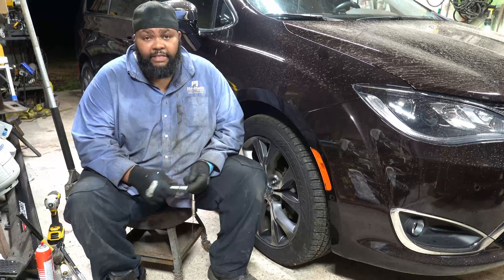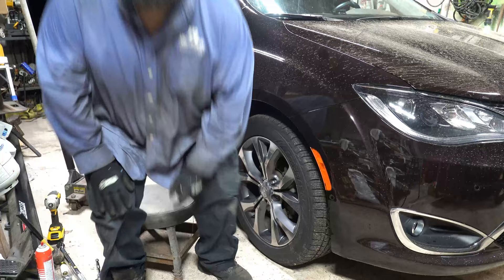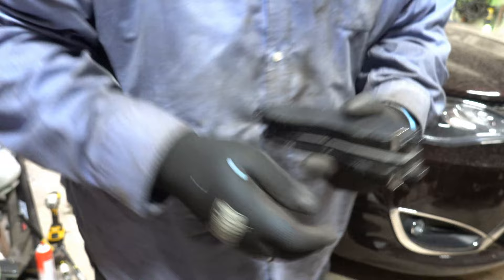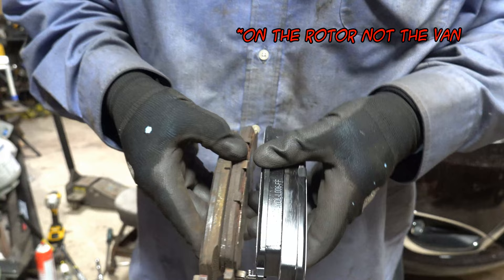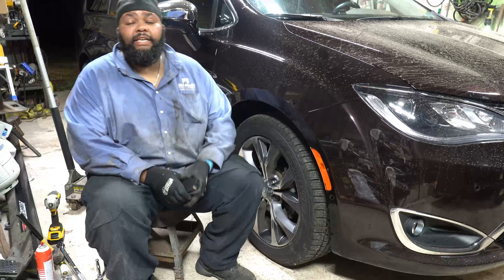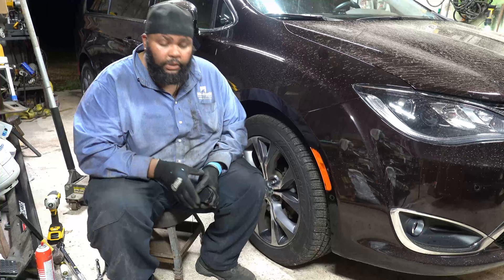The next thing is to get your brake pads. Here are the new brake pads, and here are the old ones — there was still a decent amount of life left in those old pads. This was the rear pad, this was the front pad, and you can see there was still life left — I hadn't even got to the wear bar where it starts squeaking. The problem with my wife's van is the rotors are warped, and when you apply the brakes hard you get that wobble in the steering wheel coming to a stop from high speed.